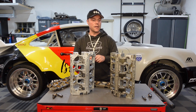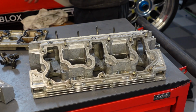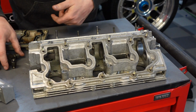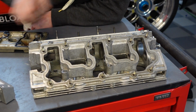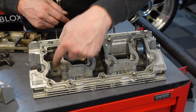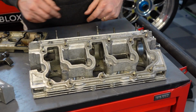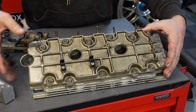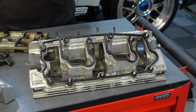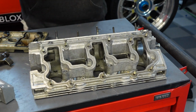And I'm going to explain this in the sense of oil leakage and in the sense of performance of the rockers. Okay, so I'm going to try to explain the sealing concept and why I believe that all of these 964 engines are leaking, or actually why my Porsche 964 engine was leaking. So this, of course, here is the inside of the engine, right? That makes sense, right? That means the outside of the engine is here. The outside of the engine is here and here, so we want to keep the oil on the inside here, obviously. And this cover, it sits like this, and it makes sure that this is the outside of the engine now. This is pretty obvious, all of these things, right? This one is sealed off with a molded gasket here, or molded rubber seal, and this is good. This is good, it works well.